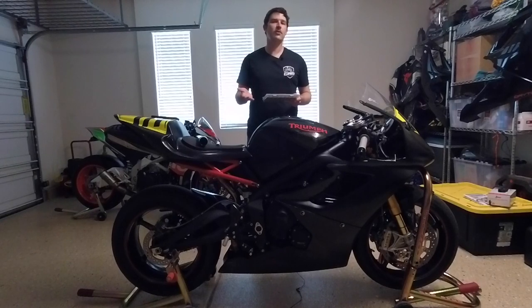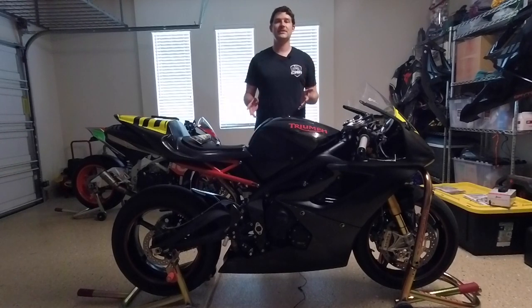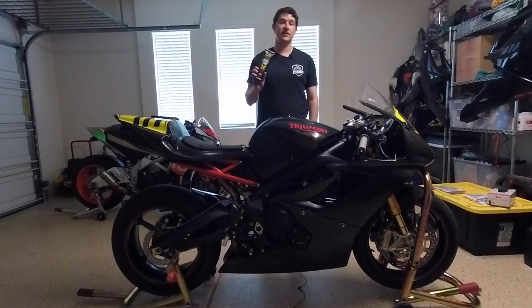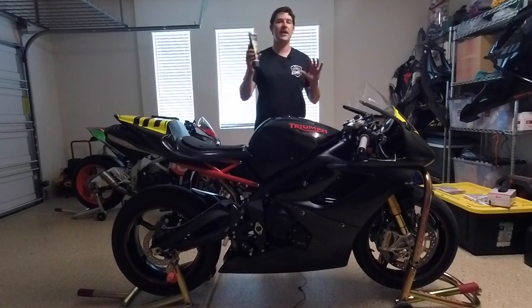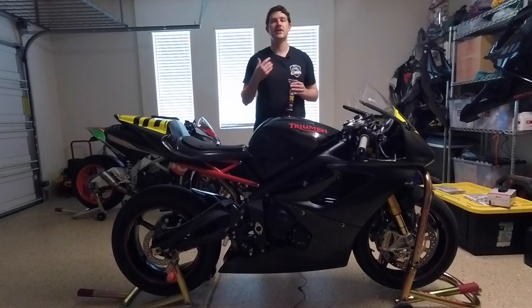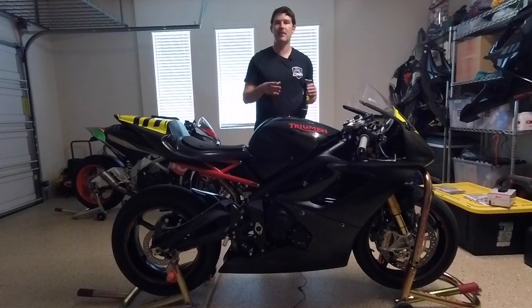And your Triumph dealer will be able to help you out there. So the last specialty item that we're gonna need for this job is some engine assembly lube. This is going to be key for when we are putting the cams back in the cylinder head, bolting them down with the cam retainer, because the cam journals, the cam lobes, basically everything that moves and has friction against other parts is going to need to be protected and lubricated for when you go to start the engine up for the first time after this job.